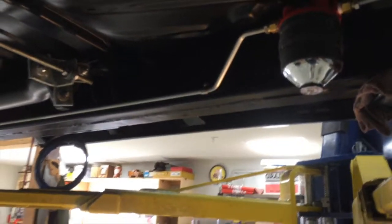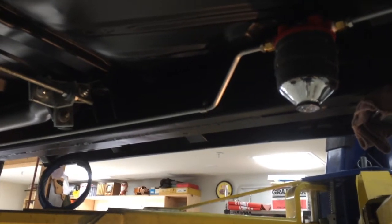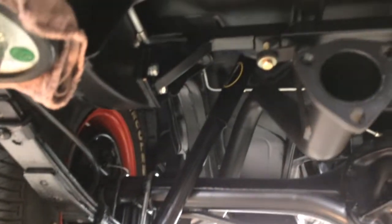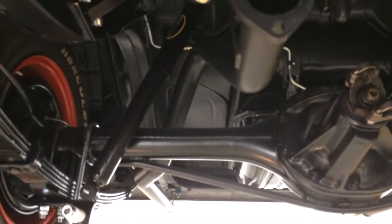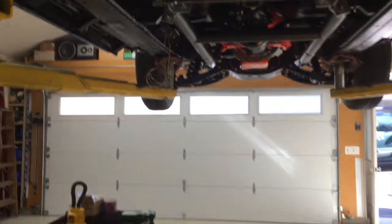What goes in the middle here is the mufflers, and when you put that all together, everything should line up. We were having a big problem with that yesterday. That wasn't happening. And if you did get them bolted up, there was a lot of pressure on those hangers, and when the exhaust gets hot, it was going to destroy those hangers. So I think we have it now, because there was going to be tension on them.